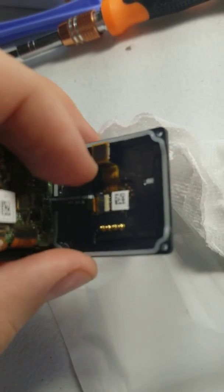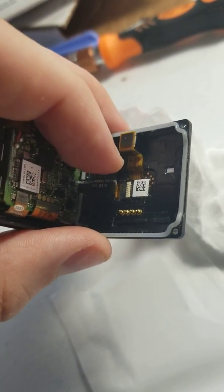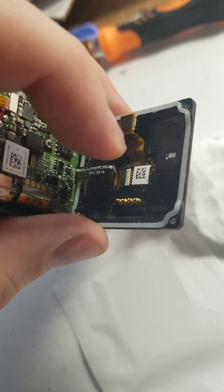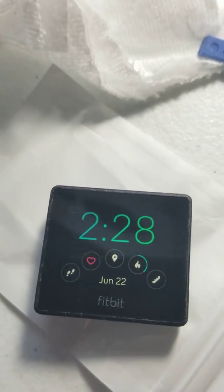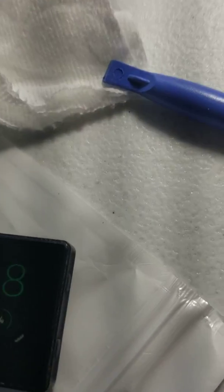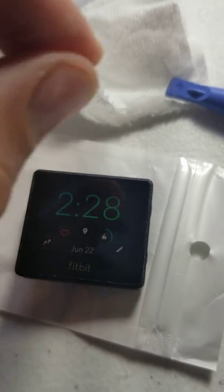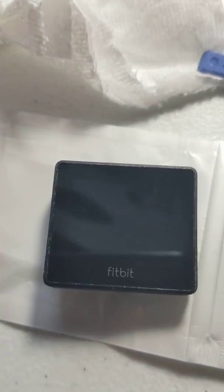This part was a little difficult. With your fingers, wiggle it back and forth — I didn't use tweezers because I was worried about crimping it or breaking any of the connections. Once you wiggle it back and forth, use your spudger and flip that little white clip back down to hopefully lock it into place. Then you can put the back back on. Once you've got the back back on, you can press the button on the side and hopefully it fires up. And now we finally have a completed process from going from a cracked LCD back to something that appears to be functional. Once it's back together, you can do a little more work to clean up that adhesive. Highly recommend avoiding water because that gel probably won't have as much of a waterproof seal as the original.